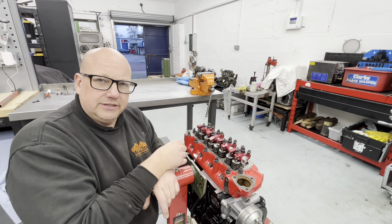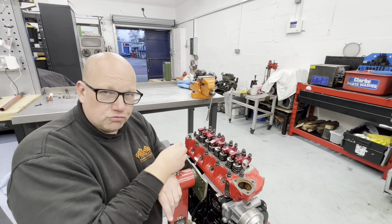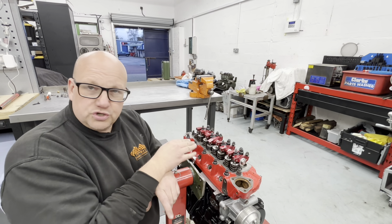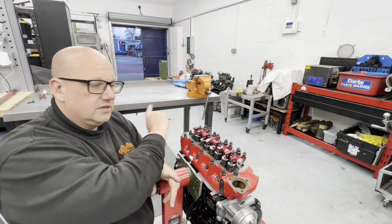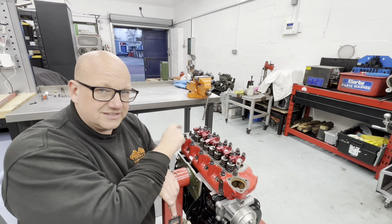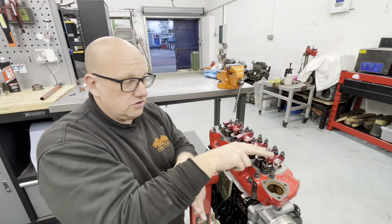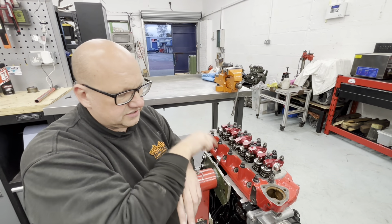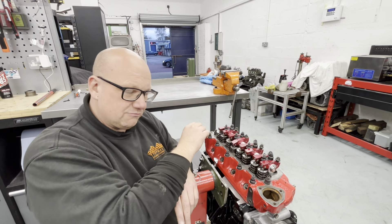Took a lot of flack for that one. Lots of people say nothing wrong with roller rockers on road cars and this, that and the other. I don't advocate the use of them on a road car. However, this engine is one we're just coming to finalize for a customer. We've been asked by the customer to reuse his current roller rocker setup — kind of against my advice. These are 1.3 ratio and this is a forced induction motor, now running the Specialist Components AC Dodd forced induction camshaft.